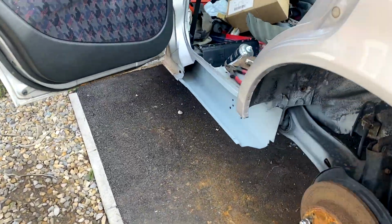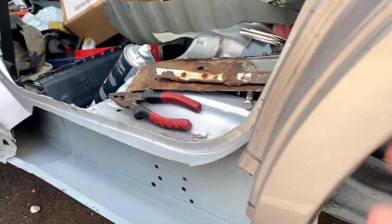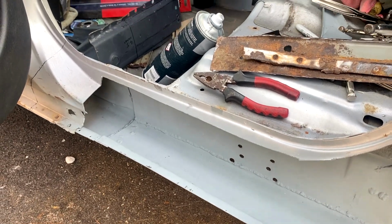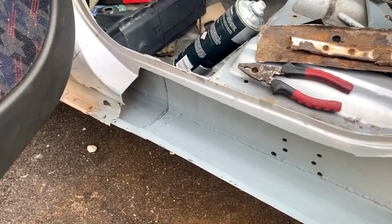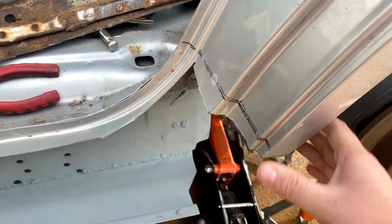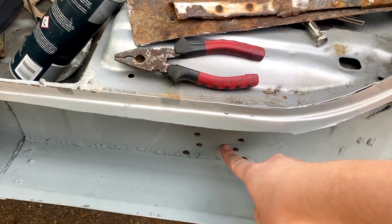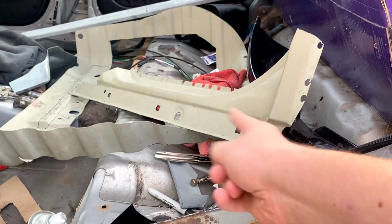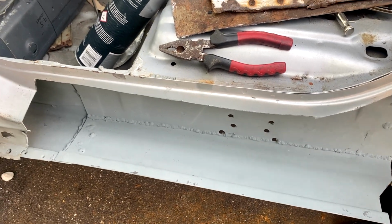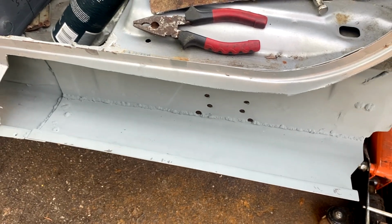So the next bit I need to do is get the wheel arch bit in, which will probably be in the next video. To be fair, I think this sill section will probably just be in three parts because I don't want to keep them too long. So the next bit will be the wheel arch, the little panel there, and I'll put the reinforcing panel in, and the jacking point, and then finally the top bit. And then it's all painted and then all waxed inside and protected from rust.